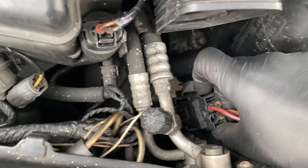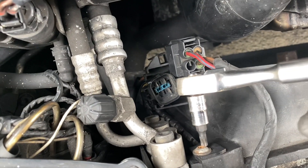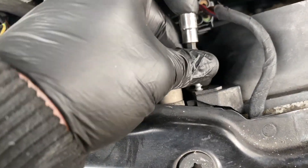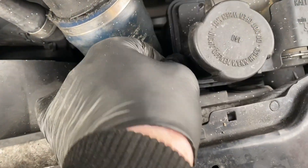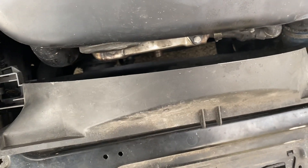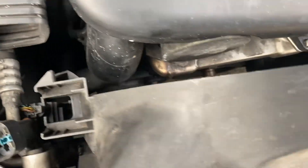The fan is removed and in a safe place. So it's time to remove the cowl - disconnect the fan first, and then remove this torx bit, this T25. Putting it in a safe place, not forgetting this stupid plastic rivet. And the fan cowl should be able to come out - there's something there that I need to pull off, I can't remember what it's for, but it needs ticking off. It just clips into place. So now the fan and fan cowl just pulls out.